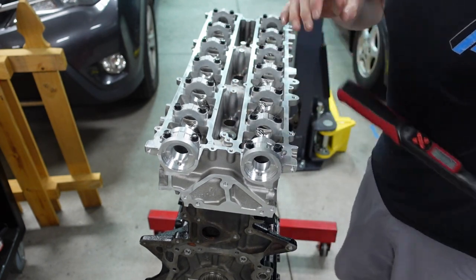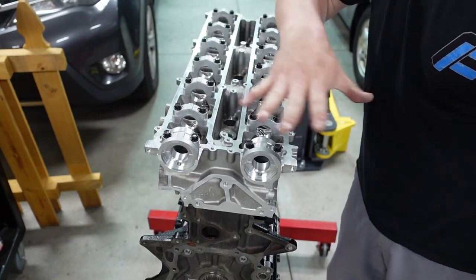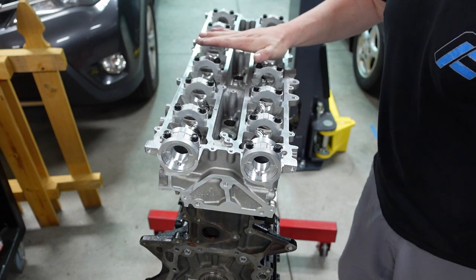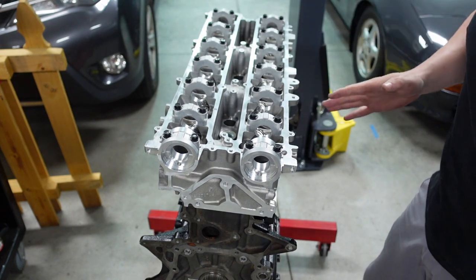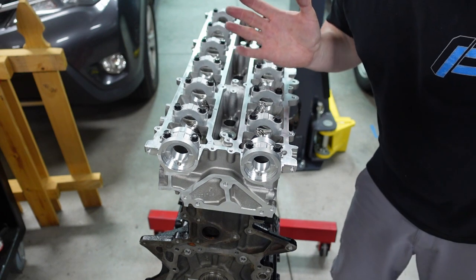And that, guys, is 100 foot-pounds. So we're done. 33, 66, 100. So she's nice and cranked down. I can see just from looking at the camera now, this has moved around a good bit, but that's cranked down. That's what it's supposed to be set at. So heads on, like I'm pumped. It's centered on, heads on, gaskets on. Yeah, sweet. So now onto all the other fun stuff.